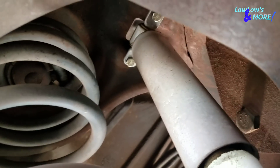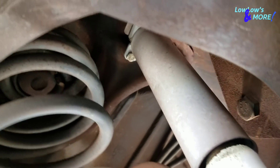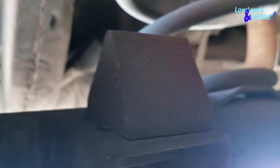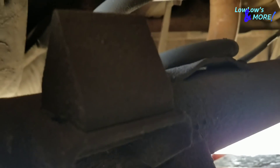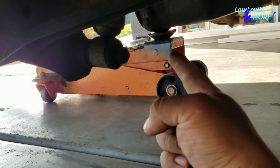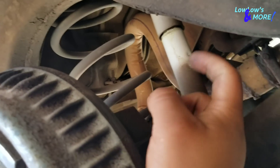For those that don't know, you take off this nut and bolt right here, and you do the same up there — there are two nuts and bolts up there — same thing for the other side. Springs usually just sit in here because they're slightly compressed. After we take off the shocks, we'll see how low the axle will actually drop. I've got the jack underneath the axle so I can take these off without too much tension on them.